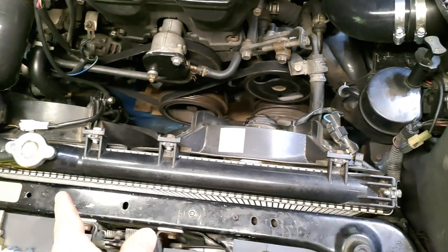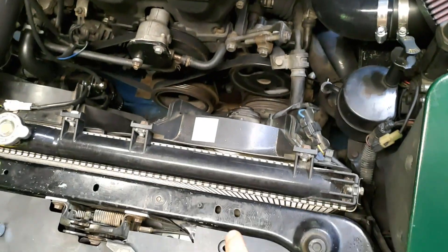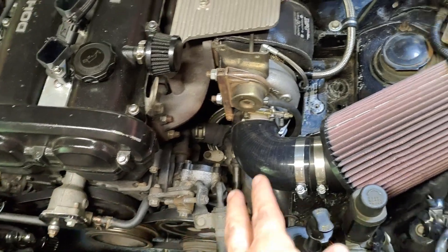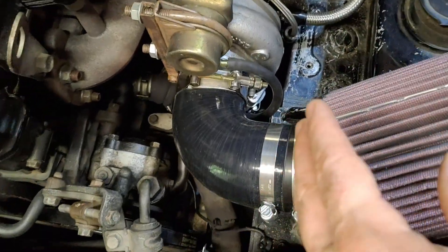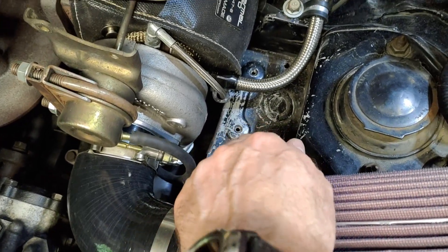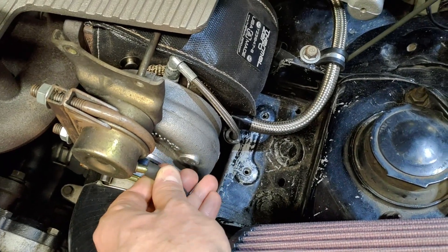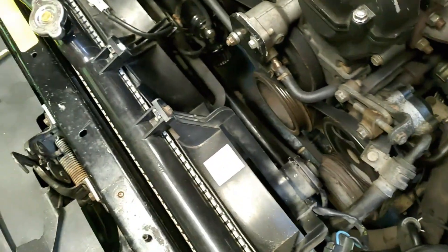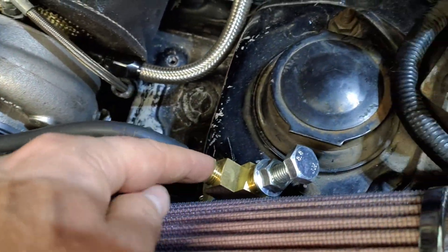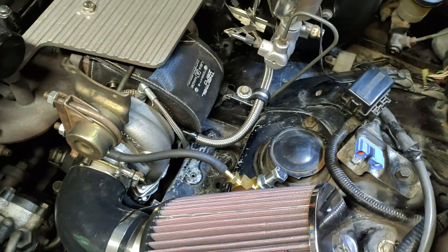In my case, I know it's about 1 to 1.5 PSI of pressure drop, so I can just take that into account. I don't have to run extra vacuum hose across the engine — I can mount everything right here. I just need to find a place, maybe off the top of this tower or a bracket off the threaded holes where a previous airbox bracket was. For testing purposes, I can just hang this off here — pop the hose off, route it onto the controller, get a little length of hose, and connect them up. I zip-tied it in place so it won't flop over, keeping it in basically the same position for testing.